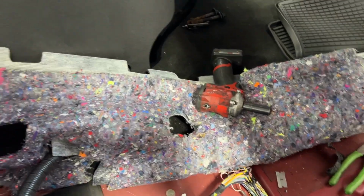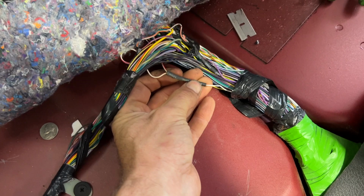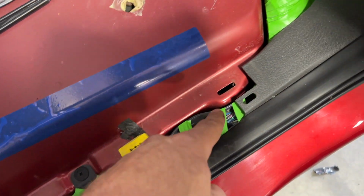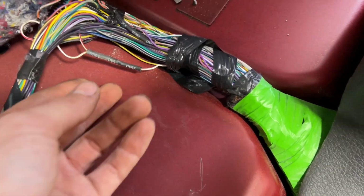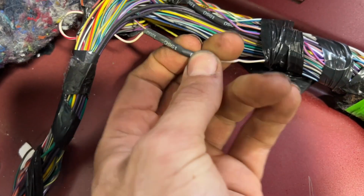So like I say, first thing I would check would be the fuse. If the fuse is good, I would come straight to here and check this splice. Somebody could have spilled a drink on the carpet. We do have a sunroof. The sunroof track could leak. I've seen times where this fills up with water, and obviously this is a channel here and it could have just backfilled right into the channel. I don't feel no remnants of water right now, but it definitely got in there.